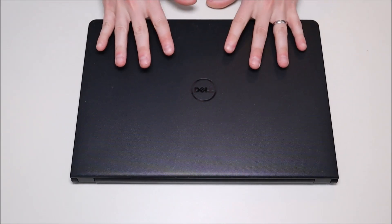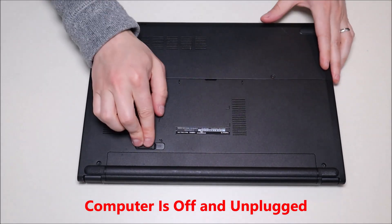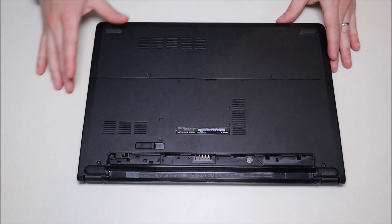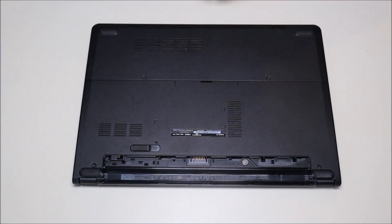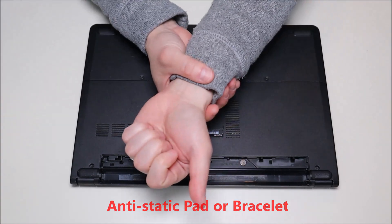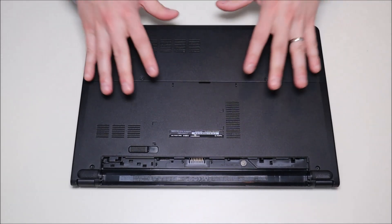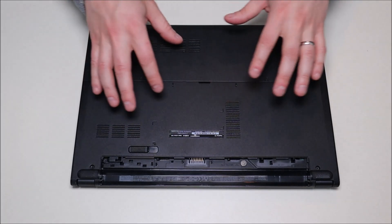Okay so now let's get into the computer. First thing we're going to do is make sure your computer is turned off, make sure the power cord is unplugged, and we're going to remove the battery. The first thing you do in any computer repair is make sure it has as little power running through it as possible — that way we don't risk damaging anything inside. Another great way to avoid damaging things: as you can see my computer is sitting on an anti-static pad right now. Either that or get yourself an anti-static bracelet, but any anti-static options like that are really good to make sure your computer has as little chance as possible of damaging anything once we get inside.